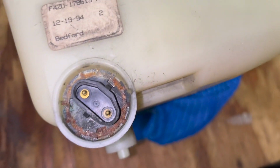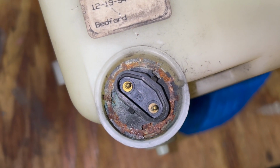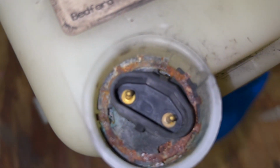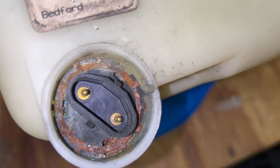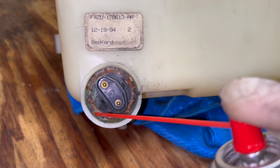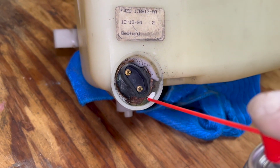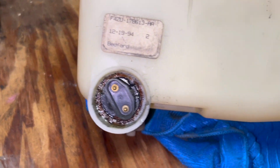the pump. So it's got this almost like very thin metal nut holding the whole thing in, so I guess all the teeth going around, I'll try to pry those out, see if we get that nut out first. Then maybe the pump will just pull out after that. And it's pretty rusty, so what I'll do first is where the teeth make contact, I'll just spray a little of this Power Lube, basically WD-40 or PB Blaster, and then try to carefully work that nut out.